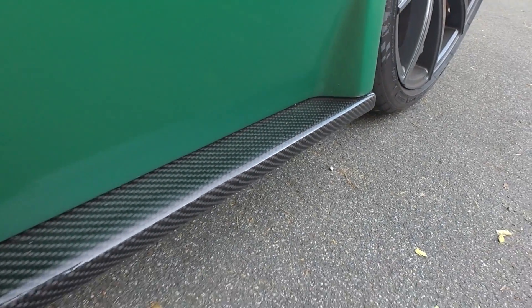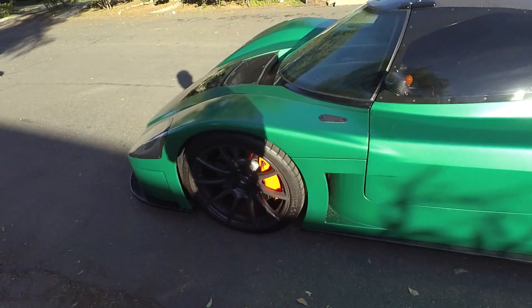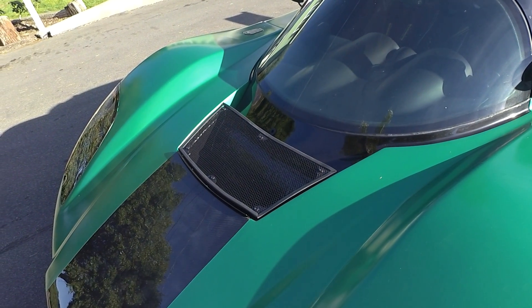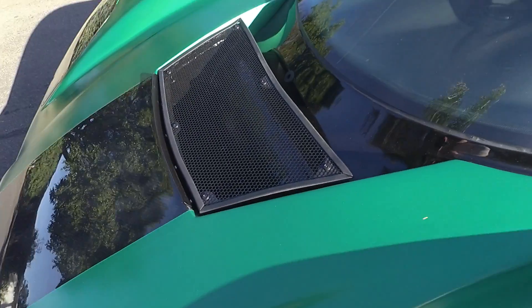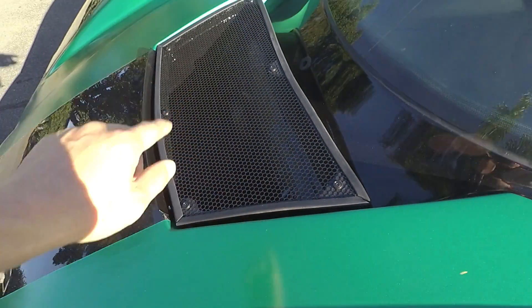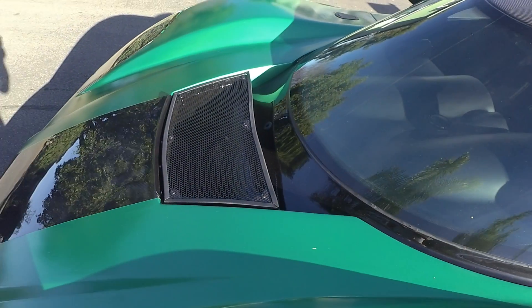Kind of hard to see, but it turned out pretty nicely. Started out with the fiberglass piece and then I skinned it in the carbon fiber. At the front, I opened up the rear discharge of the radiator duct, made it larger, and actually made a radiator box that directs all exhaust air from the radiator through this duct and out through this opening with heavy insulation throughout.